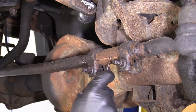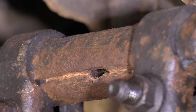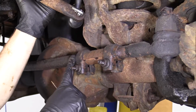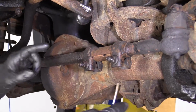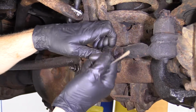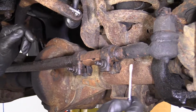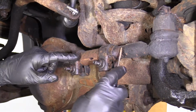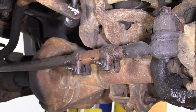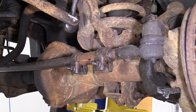on the inside of this sleeve being good is just so minimal, because all they're doing is sitting there collecting rust and rot. And when you're dealing with steering and suspension, you want to make sure that you're being as safe as possible and you have as strong material as possible, because the last thing you want is bad threads on either of these two pieces and this pulling right out, okay? Because you're driving down the road, your wheels are going nice and straight. Next thing you know, there's no threads holding this in except for just the tightness of this. It just slides right out. And I don't want to think of any worst case scenarios, but I'm sure you can.